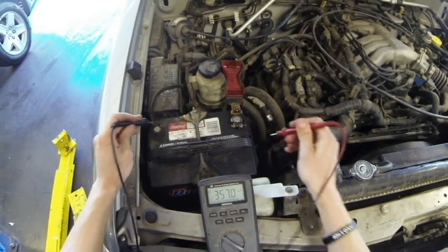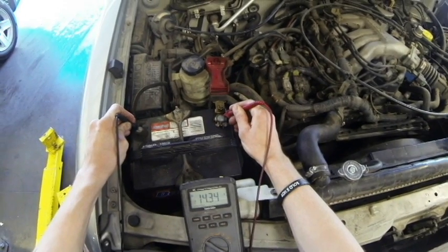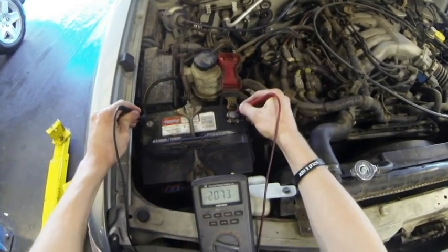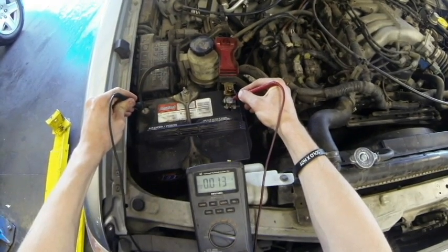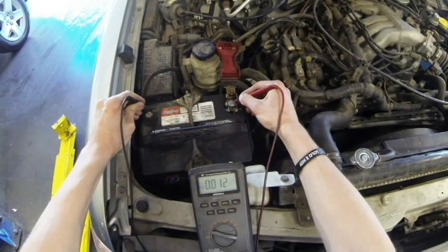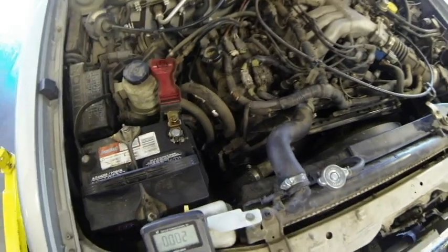Here's what DC should look like. Remember I said the 14-volt range? We're reading 14.35 — that's good. So we know the alternator is good there as far as voltage output on DC. Now checking AC, 12 millivolts is well acceptable — that's well below 50 or even 100 that some vehicles call for. So in this case we're good. We know our diodes are good and our output is good.